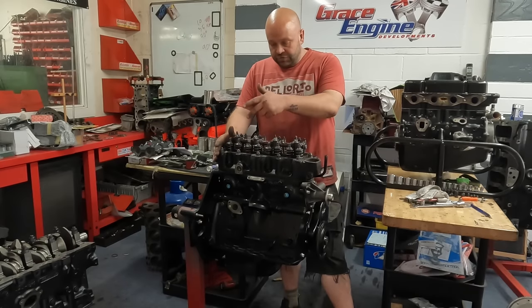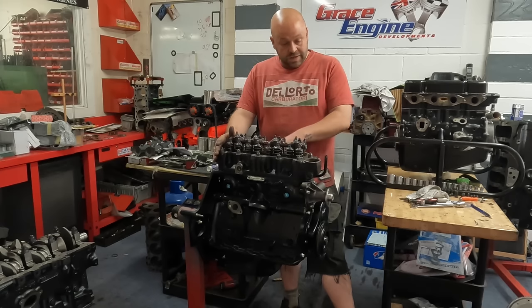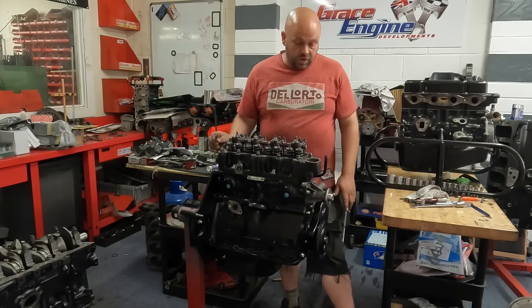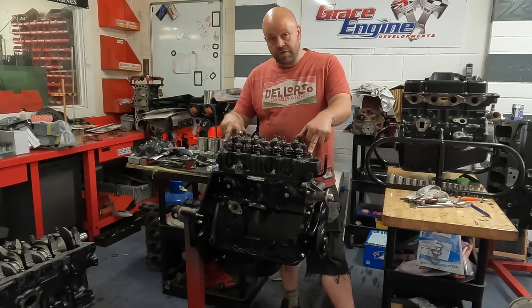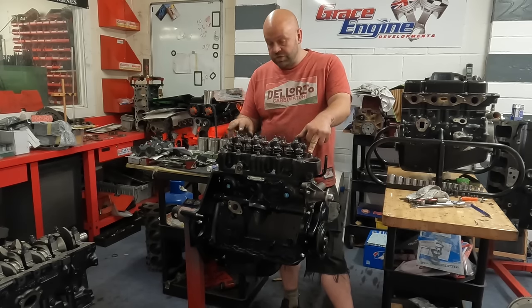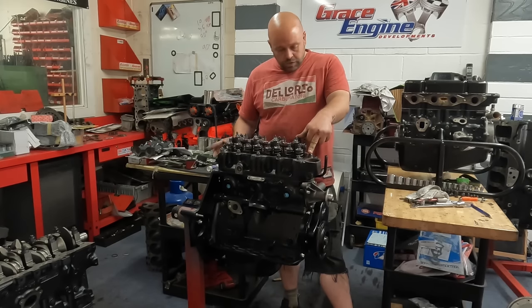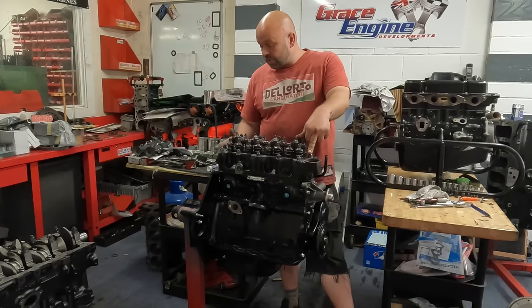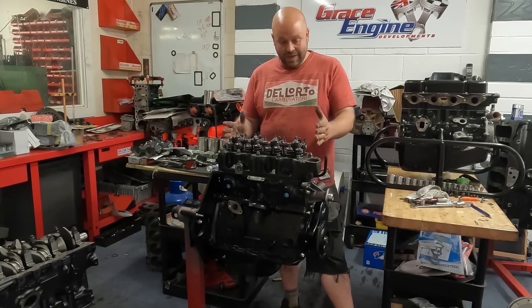Brand new set of valves, AE valves, brand new rocker shaft, gas flowed, lead free converted, new valve guides. I've used the original studs and nuts on the cylinder head because they were in very good condition, and the old original stuff is actually better than the remanufactured. I've high flowed the oil pump, reground the crank, balanced the engine, reground the flywheel, and set the tappets to Kent Cams' procedure.